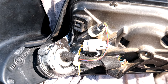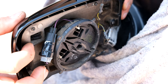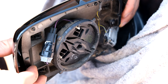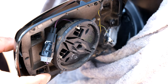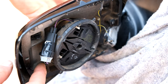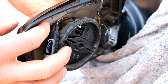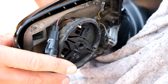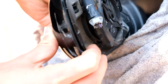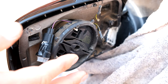There are little plastic fingers that feed through — there, there, and there's another one towards the inside. This fits on perfectly so I have not obstructed it with the epoxy. However, in the damage it did break some of these clips, so even though they are going in nicely they're not clipping in nicely — I might have to glue this on as well. But just having a look at the fitting, yes the fitting is fine and yes it can move nicely, there's no problem. So all I need to do now is build up that additional epoxy and let it dry.